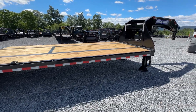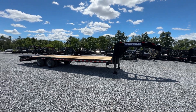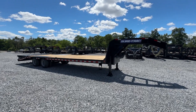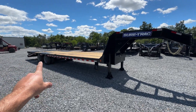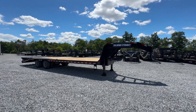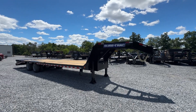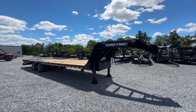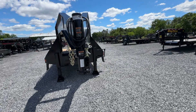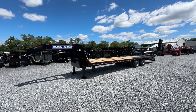This trailer is going to weigh in at about 9,000 pounds empty. And I should clarify — this is a true 30K trailer. Two 15,000-pound axles equal 30. A lot of times you'll see folks do a 16,000-pound axle and call it a 40,000-pound trailer, which is counting in 8,000 pounds of tongue weight. The reality on this trailer is 30K. It'll weigh about 9,000 empty, so you're going to have about 21,000 pounds on the trailer axles. Pin weight depends on how long the trailer is — we typically estimate 22%. Using 22%, you're going to be upward of around 6,000 pounds on the pin. So you've got 21 on the trailer and about 6 on the pin, taking you to about 27,000 pounds of legal payload. A lot of those trailers that say 40K — sounds like you're getting 10,000 more GVW, but the reality is you're only getting about 2,000 pounds more axle capacity.